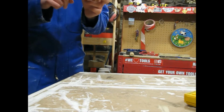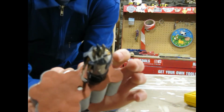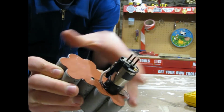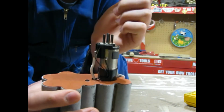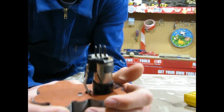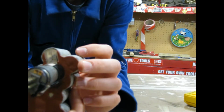So I'm just gonna really quickly walk you through this. So really, we don't need anything out of this. The only thing that we need is this cap and, see these 2 black wires on the side here? That is the heat detector. It tells you when your battery is full. It tells, not you, it tells the charger when your battery is full or not. So if that's damaged, you have to get a new one. You can't just replace the cells if this is busted.